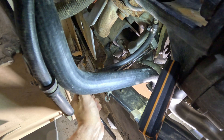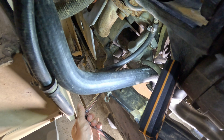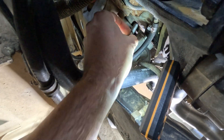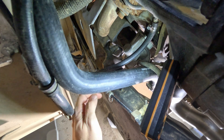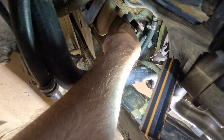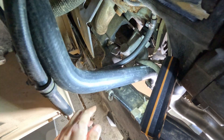With the splash guards not in place, this is super easy. I've got a bucket underneath to catch all the diesel coming out. With those two bolts, the pump is free and I can lift it out - you can kind of hear the push rod in there.